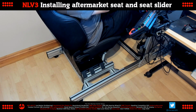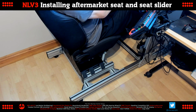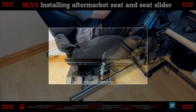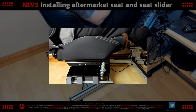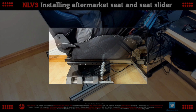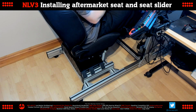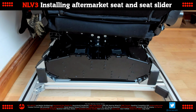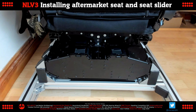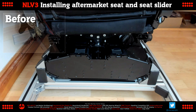These new Speare seat sliders have no play in them, so that problem is now fixed. And they also have a greater range of travel than the old set, which is another bonus. With those aluminium standoffs removed, the seat is now set lower, which meant I was no longer positioned in my sweet spot to the steering wheel and pedals, and that's just a mere 3 centimeters difference in height, but it was very noticeable to me.